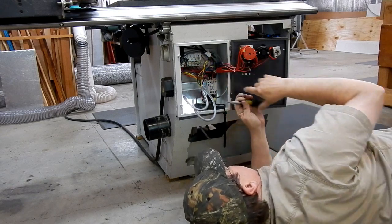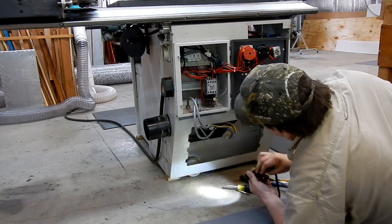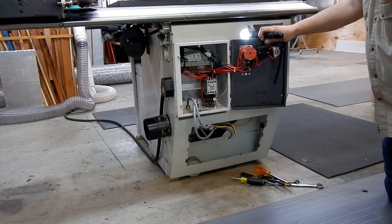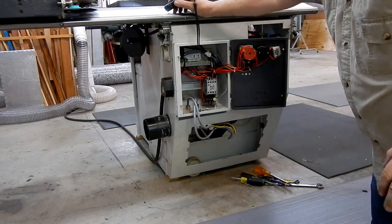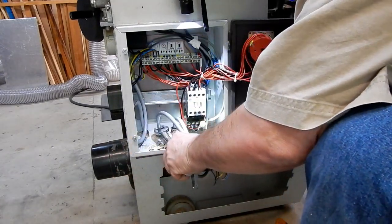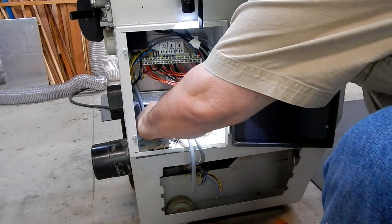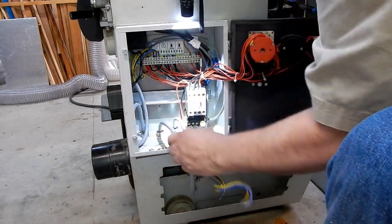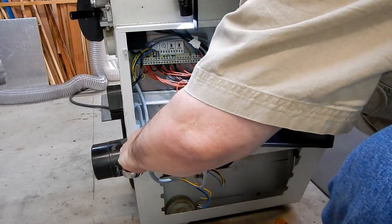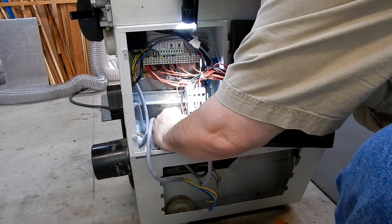Now I just have the two ground wires to take loose. Taking these out originally was a little bit hard because the grommets were stuck onto the outside of the wire. I had to pry them loose and then take some isopropyl alcohol and put it down the fittings to make them slide out. Both these nuts have got to come loose up here on the top — 19mm works on that one, about 20mm on the other. I'm just going to unscrew it a little bit.